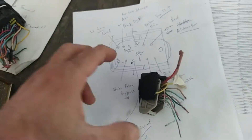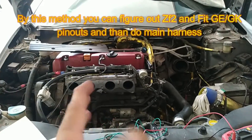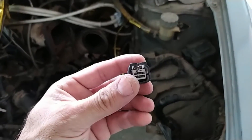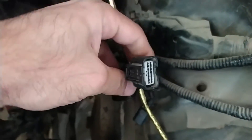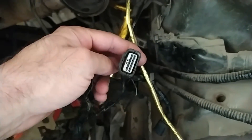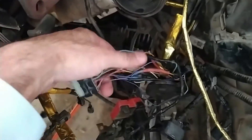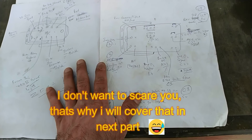This covers our C124 connector of the Honda CRZ ZF1. Similarly, you can easily figure it out on your Honda Fit or whatever platform you are working on. Along with this connector on the CRZ hybrid, there is a small extension connector - this was my Honda Fit hybrid and this is the connector which appears on the CRZ. This is no longer needed because we have removed the hybrid system, so don't worry about wiring that extension. We just need to wire the C124 connector. I cut it out and replaced it with the SI-type connector from the junction.